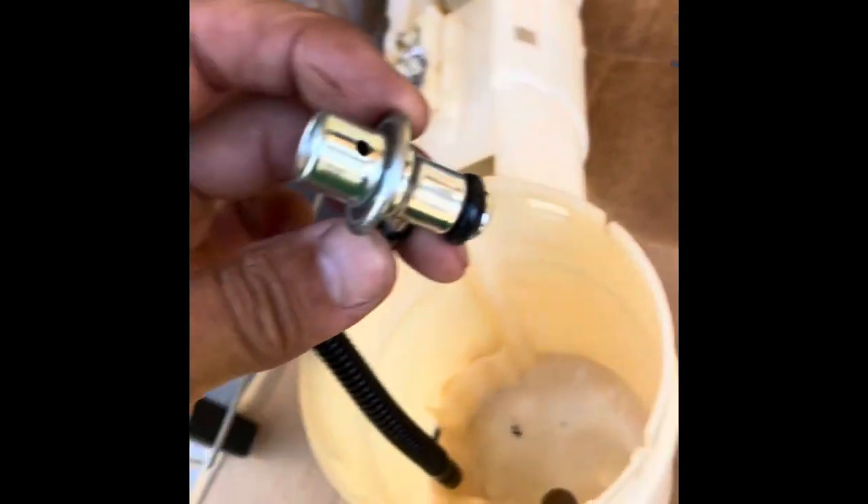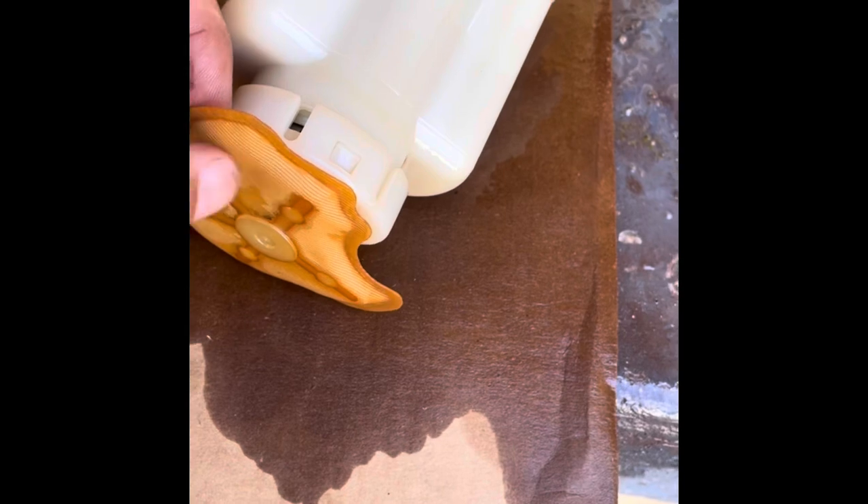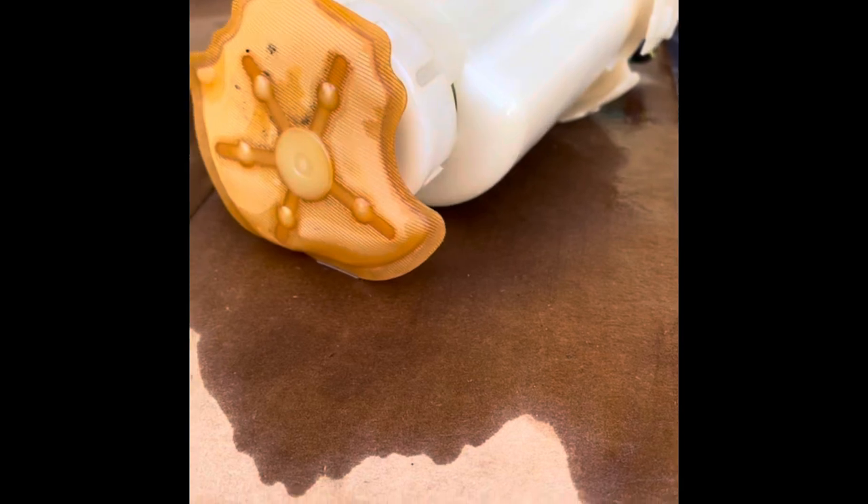It came out just as planned. There's an O-ring on the bottom and a little bit of crap in there. I believe my problem is the gel in the filter, as this fuel was gelled up from being stored in a hot container for a really long time. You better take these little clips out here — more of those.